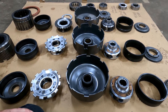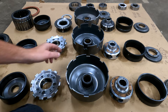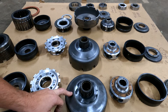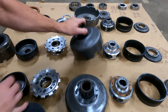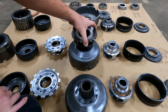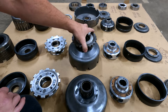The sun shells are entirely different — the E4OD and 4R100 are identical to each other. Their gears will not interchange with the C6, but they will interchange with each other because they're the same thing. The six-gear rear planet will go on the back of the E4OD gas transmission sun shell — they're the exact same thing, so the parts will interchange no problem.